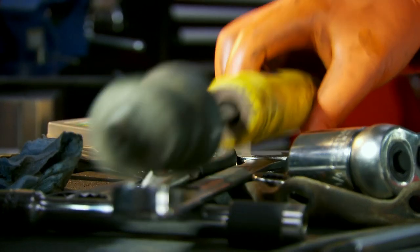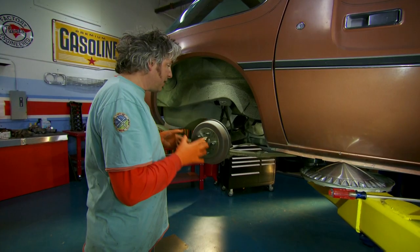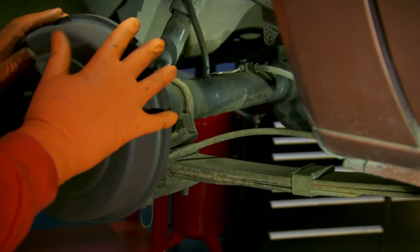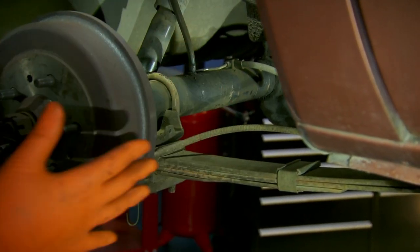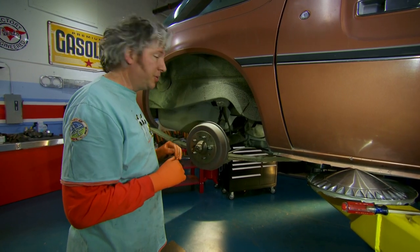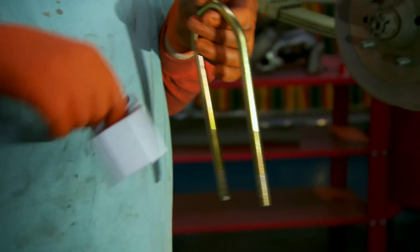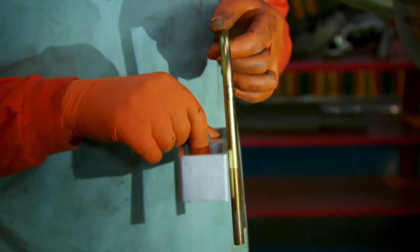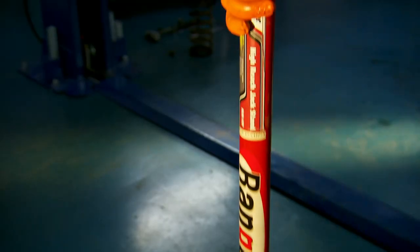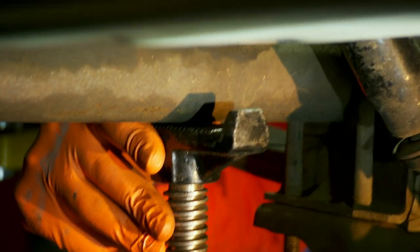The last thing to go in is the shock absorber, and that's the front done. The rear is a very different story. As you can see, the axle sits on top of the leaf spring. So all you have to do to lower the car is lift that up and pop in some kind of spacer between the axle and the spring — job done. The axle is held in place by a big U-bolt, so all you need is a block and a longer U-bolt. The spacer will force the axle up and the car spring down, bringing the wheel closer into the arch.